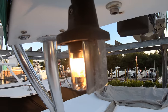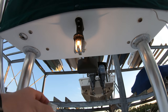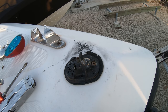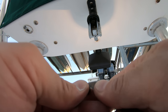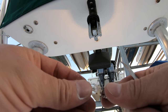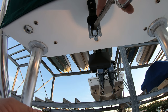The light is up and running just the way it should with minimal effort and time on your part — and this is something you need to know about when you're out after dark and turn your lights on only to find one isn't operating properly. I would call this a big plus for the incandescent regular light bulb style lights over the LEDs. Do be careful when scraping the bulb though, because corrosion can get between the glass and the metal top, and when cleaning it you can knock the metal top off and ruin the bulb. It might work in a pinch, but if the metal and glass separate it weakens the connection between the top and the wire going into the glass.